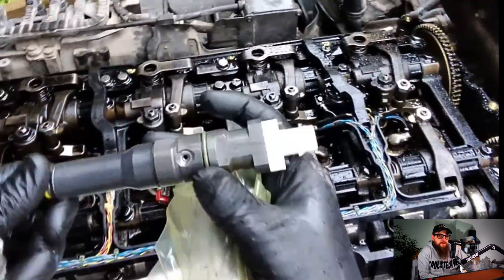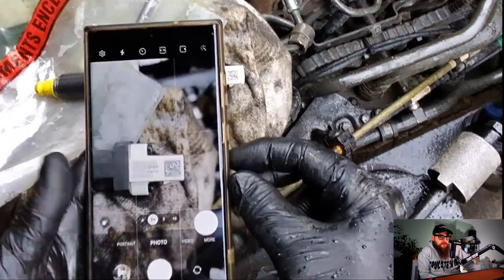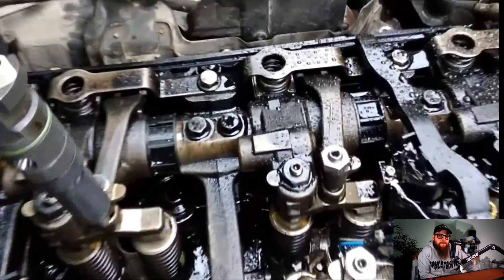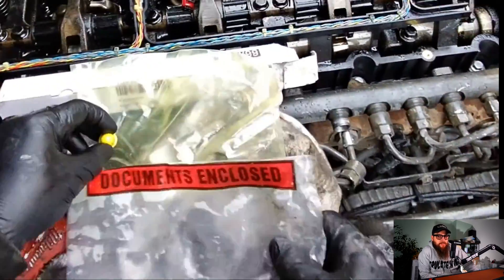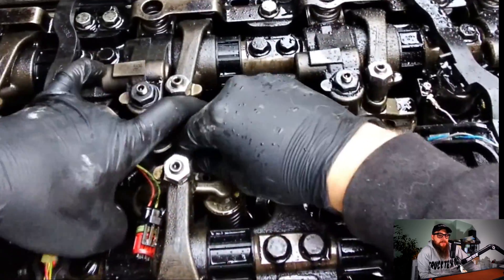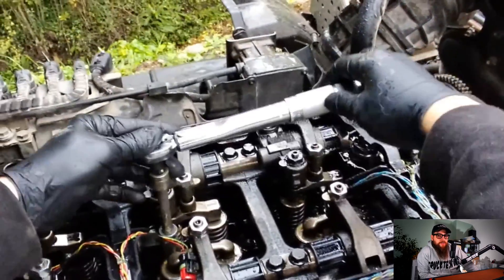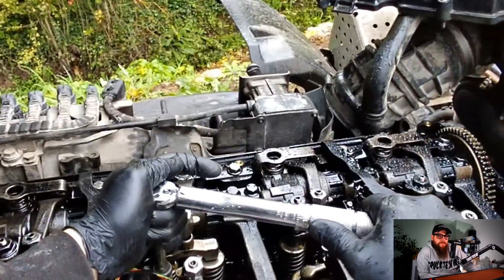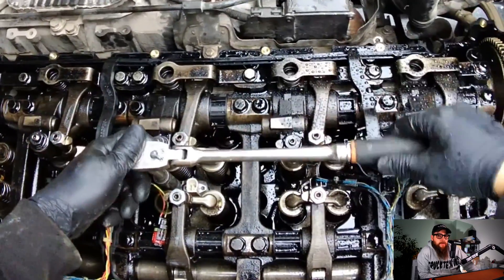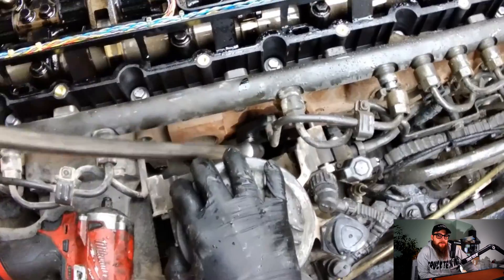With an injector from DAF sourced, it came with a new sealing ring and O-rings for installation. I also asked them for a new retaining bolt for the injector clamp. I'm just going to take a picture of the trim code for later, and we can carry on with the installation. I can remove the protective cap now and gently put this in the engine, followed by our injector clamp and bolt. I can't stress enough the need to ensure the threads are free from oil, as the last thing you need is one of these coming loose and damaging the injector sleeve. I can run this retaining bolt down with a ratchet and finish up with the torque wrench at 28Nm before I angle torque it by 90 degrees. I'm just going to run the injector pipe back in the head to ensure it's sitting correctly and then do my angle torque on the injector. I can then get my crow's foot on the injector pipe and angle torque that — not going to fall off ever — and finally the nut on the injector rail.